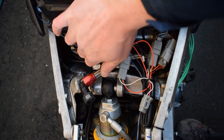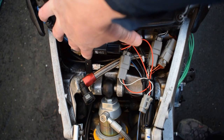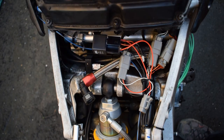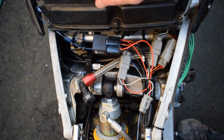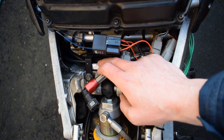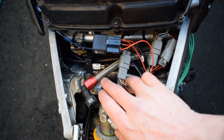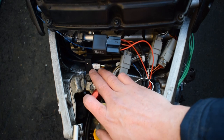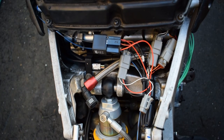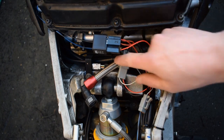Luckily on the F88R, I have the option to disregard the cam position sensor once 720 sync has been achieved. So it actually only needs to work during cranking and idle, which it does quite well. And that gives me fully sequential fueling and ignition, even though I don't have a cam sensor installed. It also doubles as a MAP sensor, so the pressure signal is there, so I may as well use it, and that gets sent back to the ECU also.